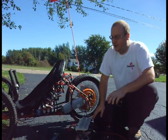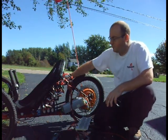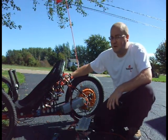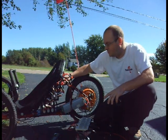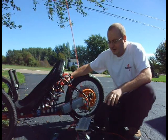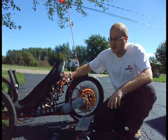At that point, I'm fully charged. I set my 99.3 volts to average 4.15 volts on every cell. Some will be higher, some will be lower, but it's okay because no cell goes over 4.2 volts, which is the maximum any LiPo cell should be allowed to charge. By not fully charging my pack, I extend its life, making it last as long as possible.